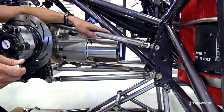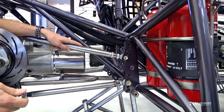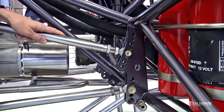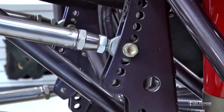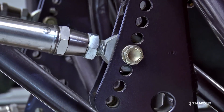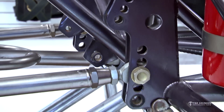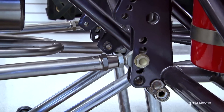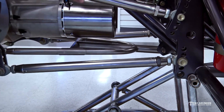So the four-link rod ends and the four-link bars need some love every once in a while — especially the rod ends. Every car that we build, they get neglected on the rod end maintenance. Just like the drive shaft, just like the brake pads, the rod ends don't last forever. They take a beating run after run and they eventually get tired and loose.